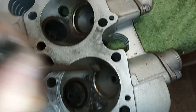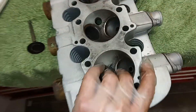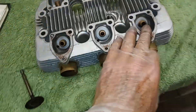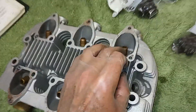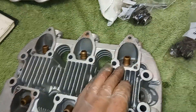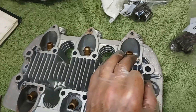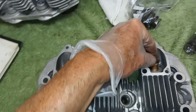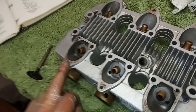So we're going to replace the inlet valve and we'll replace all the valve guides — all of these will be replaced. Also, for some reason these don't have valve stem seals on any of them, so we at least need valve stem seals on the inlets. These should have a groove that the seal clips onto, and these don't.